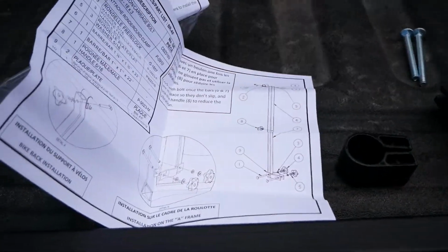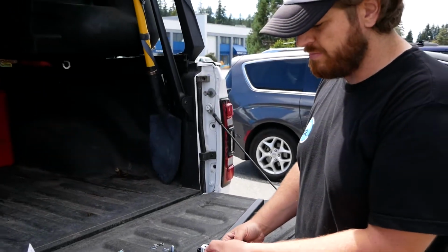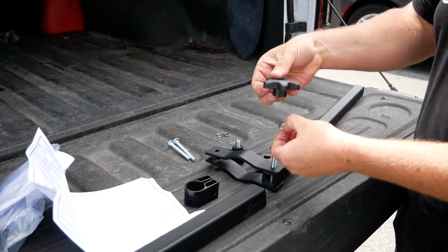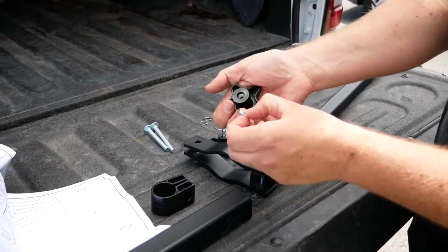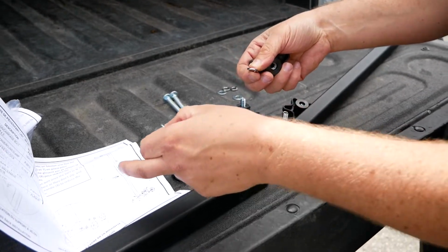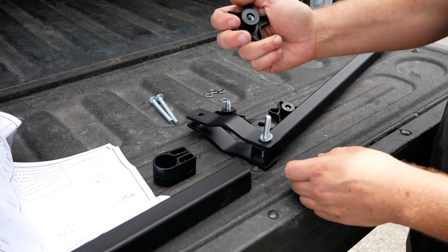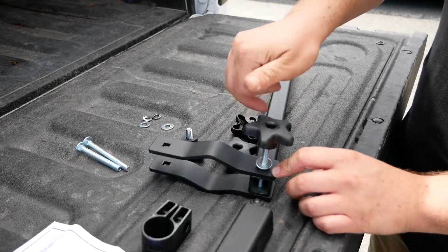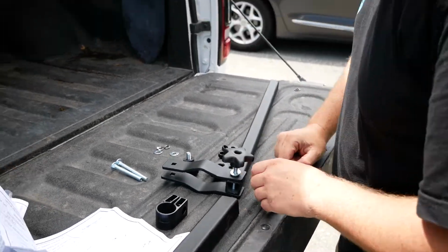So when you're assembling this, you do this a little bit different than you would normally. Your standard stack on a nut and bolt would be washer, split washer, and then your nut. But here, these are adjustable, and this split washer will carve into this plastic face. So what we're going to do instead, as per the instructions, is we're going to go split washer, washer to protect the face of this. This is already steel, so that's okay. And then we're going to spin this on, just loosely for now, because I have to get this on to the actual power jack in a second.